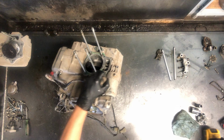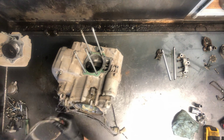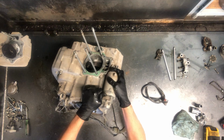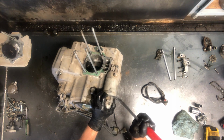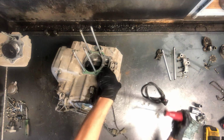And that is a nut that holds that wire on. I'm going to set that back with it. That is the hot wire coming from your starter solenoid here. And to pull this starter, then you just push that back. And sometimes you got to have a small crowbar or a large screwdriver to get that in. There's a couple O-rings that seal this up. A lot of times it does a really good job of sealing it up.